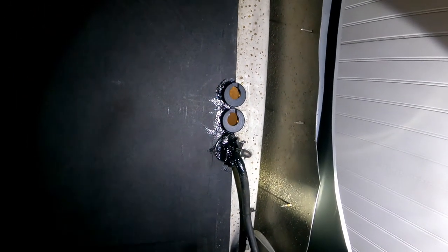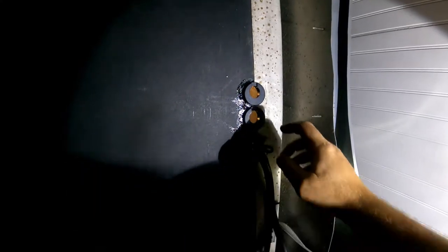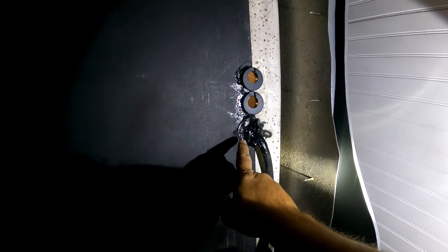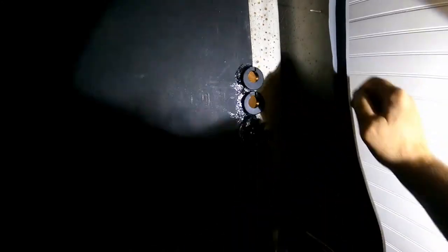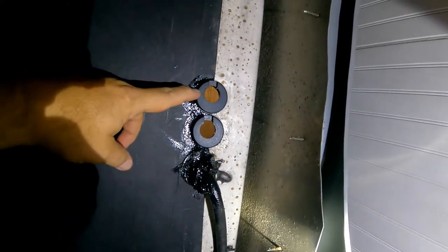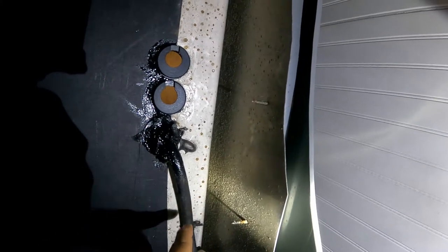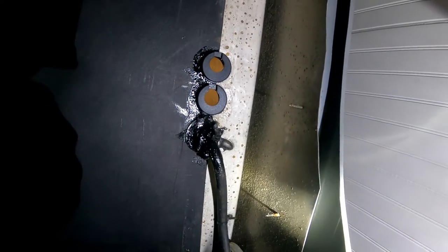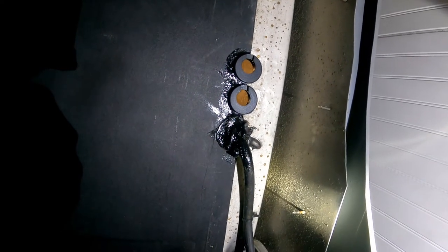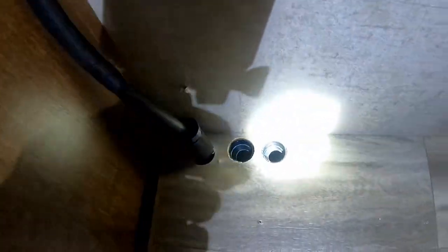I'm using some non-standard parts here. Looking across the internet, I couldn't really find the same piece that was used when the camper was manufactured, but it's just a piece of plastic — it's essentially the same thing. One hole will be the drain line and the other will be the water line. Once I get them in and secured, I'll bring them down and secure them with some C-clamps, then literally Lexel over these holes, just like I did here. I'll do that in the next couple of days.